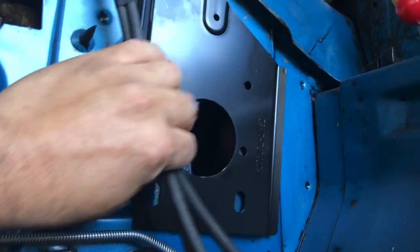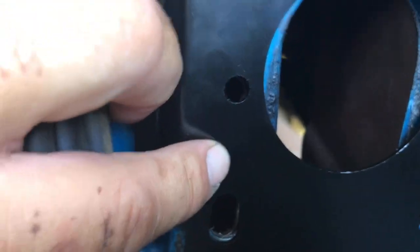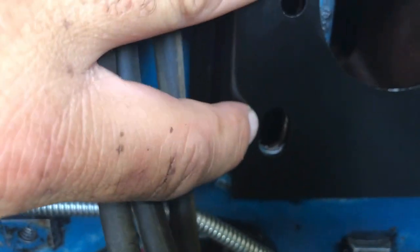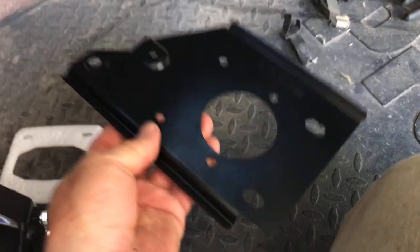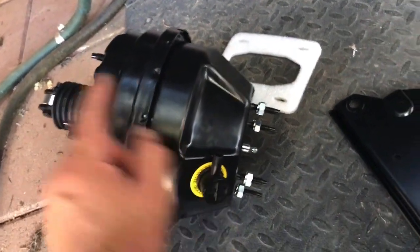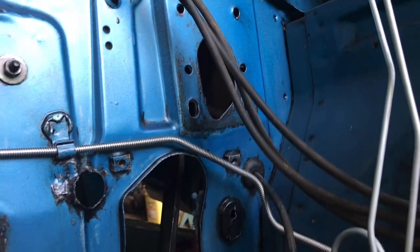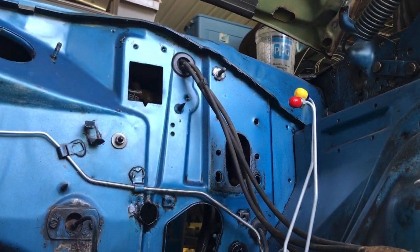Typical car stuff — I tried to put everything on here and something just wasn't lining up, and that something is these top holes. The bottom holes line up, but I think it's actually these slotted holes and that hole that are the problem. This is a brand new plate that came with the power brake booster, so the studs on the booster match this plate — but the plate doesn't match the car. I'm guessing it's because this is a drum brake car and I'm putting disc brakes on it.